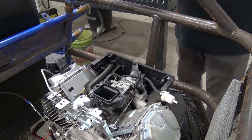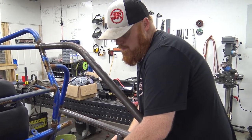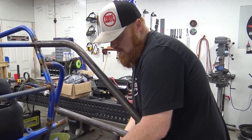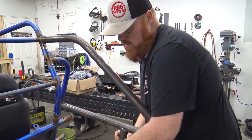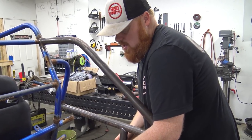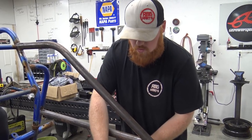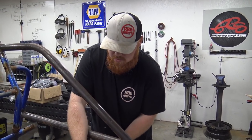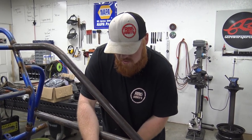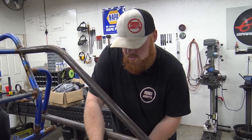There's the top of that air box. The original 670 that burnt, when it burnt, what we believe had happened was that they put really cheap fuel lines on Predators and these engines. We always smelt gas when we parked the Yerf Dog in the garage. We would smell it all through the house ever since we put that 670 on it. So it was leaking fuel somewhere, and I don't know if it was a stock pulse pump.